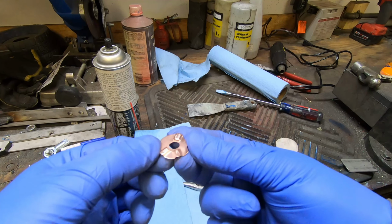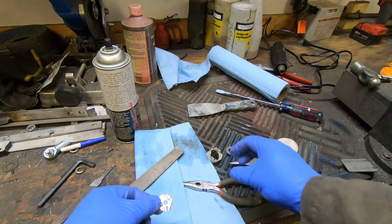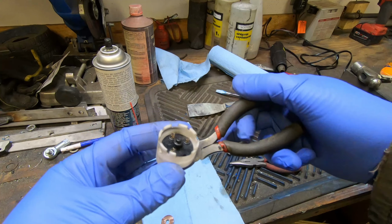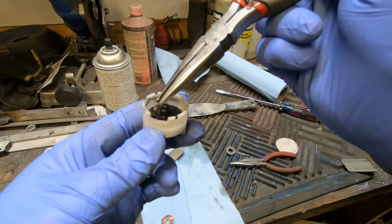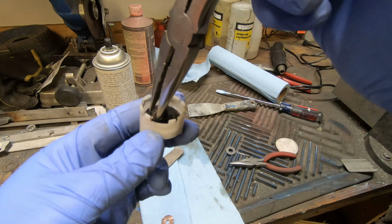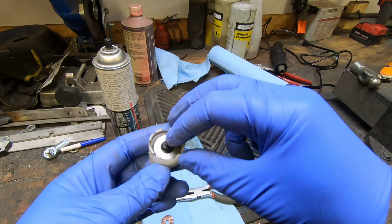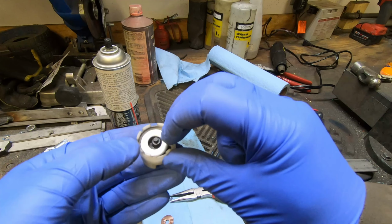Yeah, so not quite perfect. I'll get that perfect and then polish it out again. The other thing I'm gonna do though is, so this is inside the switch. There's these three springs that apply upward pressure. And I'm gonna stretch them out a bit. I already have actually a little bit, just to try to put a bit more tension on. And the other thing I'm thinking about doing too is adding a stainless spacer, just to increase that spring pressure,